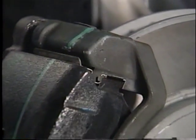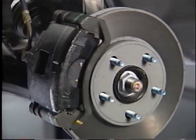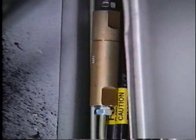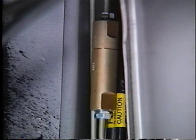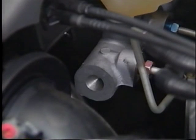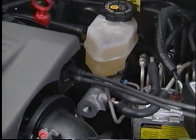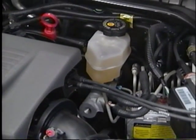For '99, the base brake system is identical to '98. There are no changes. Calipers and drums are identical. The only difference you would notice would be that the brake proportioners are now in the rear of the vehicle. The master cylinder for ABS-6 was a four-port master cylinder. For DBC-7, we went to a two-port master cylinder, which provided a path to transmit hydraulic fluid from the master cylinder to the brake pressure modulator valve, which in '99 is not connected to the master cylinder.